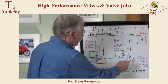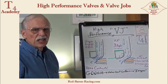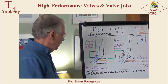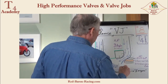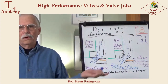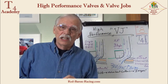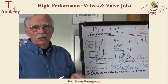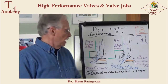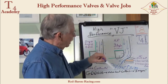Because we do away with the trips. Also notice over here — this is a back cut, 15 degrees on the valve, to take that trip out. Does that really make any difference? Well, the target airflow in the intake port is 300 to 350 feet per second. For comparison, 60 miles per hour is 88 feet per second, so we're looking at around 200 miles per hour at 300 fps and about 240 miles per hour at 350 fps — airflow hitting that edge and increasing the vena contracta, which chokes down the flow area.